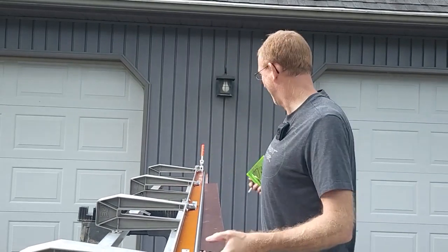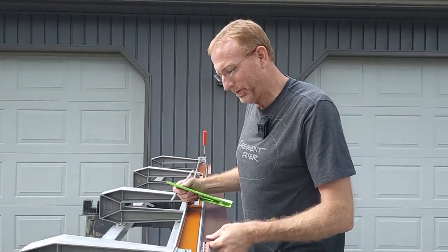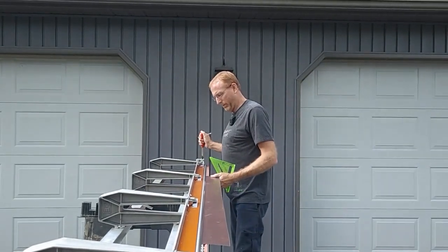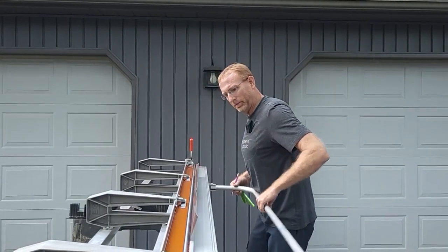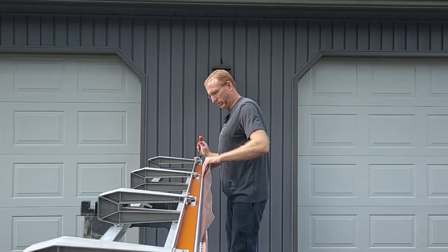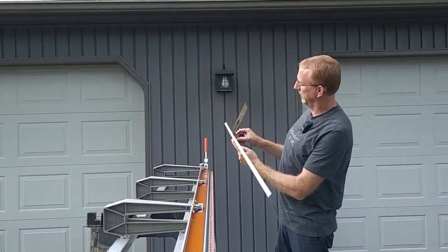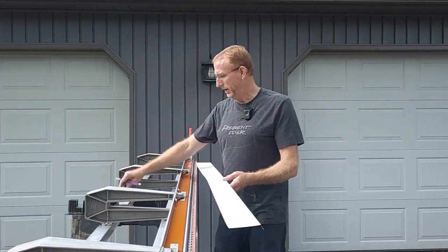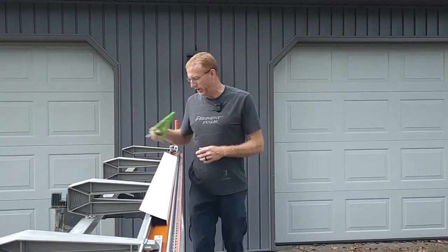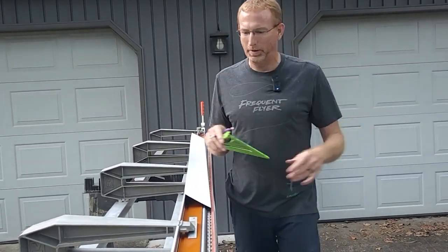Is this riveting yet, hon? Riveting — I cannot tear myself away. Don't leave yet, you're running the camera. I'm going to pinch this down a little bit and get set on my marks, clamp it down. It's almost 90 degrees but not quite, so I'm going to raise this up and check where we're at. I can use my angle duplicator to see if I'm pretty close — I nailed that one. Then on this other side we're going to flip it over and bend from the white side up to get the reverse bend on the bottom piece. This will be the lip that goes underneath the flooring and helps seal this off. I'm going to go with about seven-eighths of an inch there — five-eighths on one end and seven-eighths on the other. The remainder of that four-inch piece will be the straight section that covers the loose area of the building wrap.